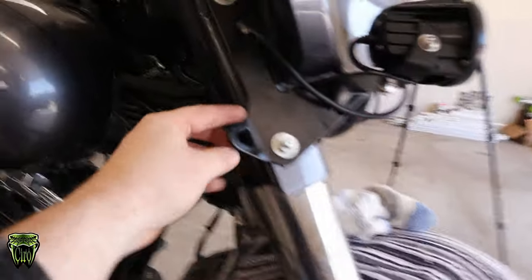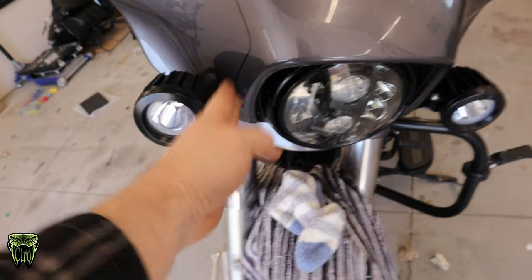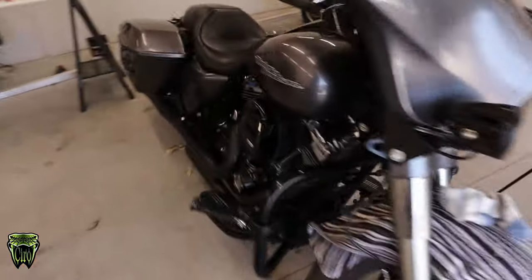Other than adjusting them so they point straight, that's pretty much it. One thing I did want to point out: when you put these on, make sure this tab is pointing away from the bike. If it's pointing into the bike, that means they're on the wrong side — it will put these lights too close in here, and then you won't be able to get your fairing on. Don't ask me how I know that. I did have them on the wrong side and I could not get the fairing on, so I had to redo everything and reshoot it because I didn't want to mislead you guys. I looked at the instructions and even though they're colored and pretty high detail, there's a little bit of an optical illusion. I didn't look at it close enough and I put them on the wrong side, so I thought I better point that out — if you do it, it's going to cause you about an hour extra work.